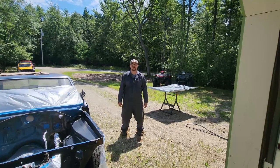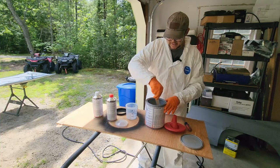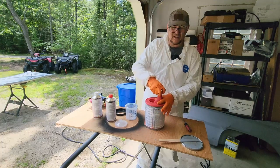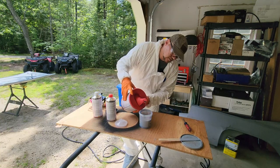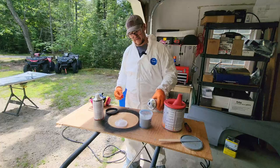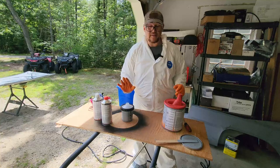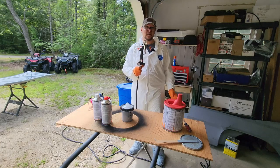The real question: spray bomb or spray gun? We're using the good stuff. This mixes up four-to-one-to-one. I'll take our mixing stick and do the mixing. Using a little cheap pour-spout thing from the home paint section - works really well. There's my four-to-one, next the reducer, and last but not least our activator. This is a standard or medium activator and reducer. Give it a nice stir, snap the lid in place, add a retaining ring, and that's ready to spray. I'm using an A610 LVLP spray gun.